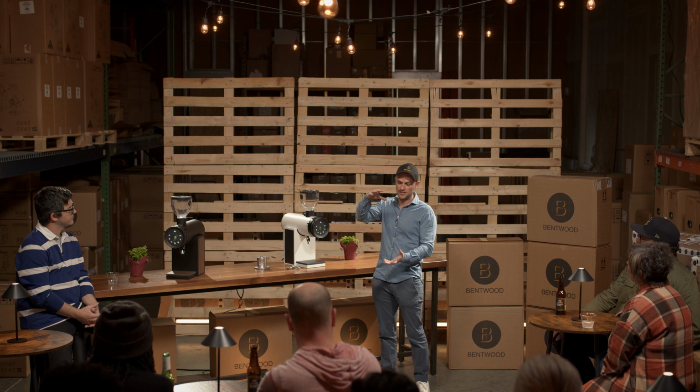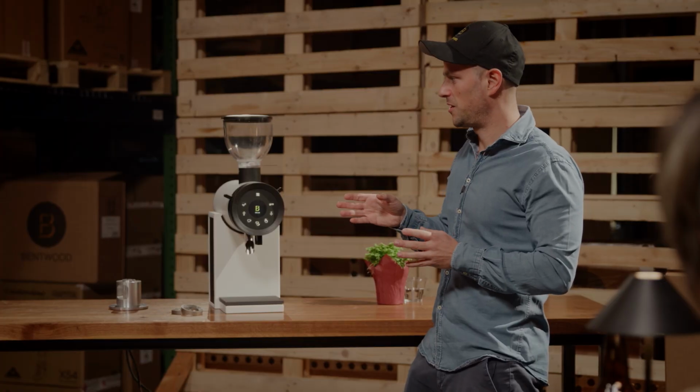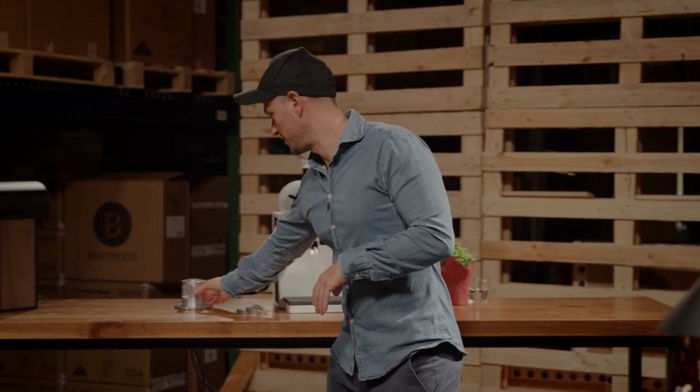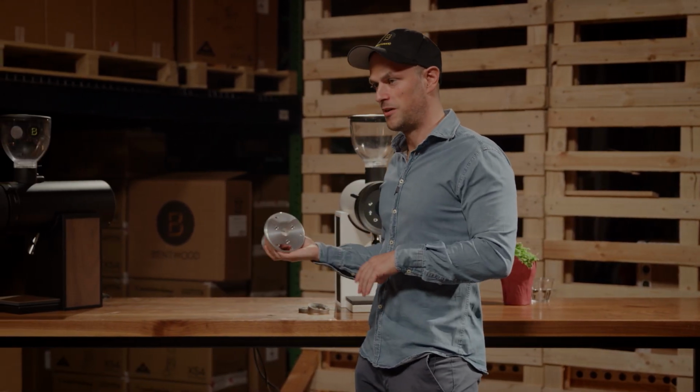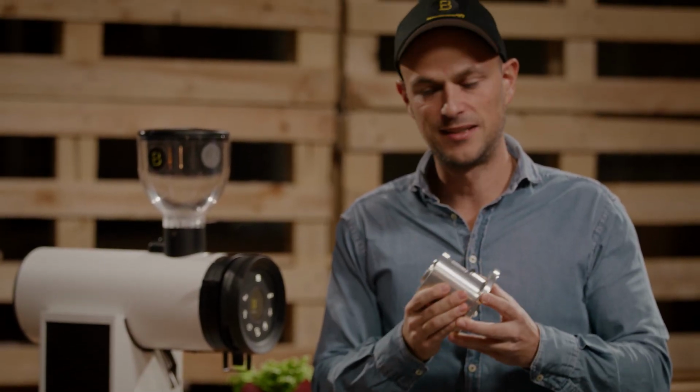So typically, inside of a grinder, you have a motor and a capacitor, you have the burr set, and that creates a module together, right? And then somehow you have a housing around. Well, here we look at it a bit like an onion. So you have layers of aluminium, and it's heavy parts. It's not little pieces, so it's heavy parts of aluminium that keep it cool because of that amount of mass.